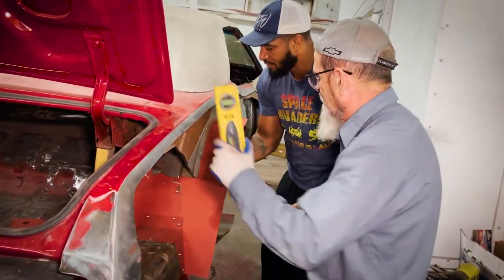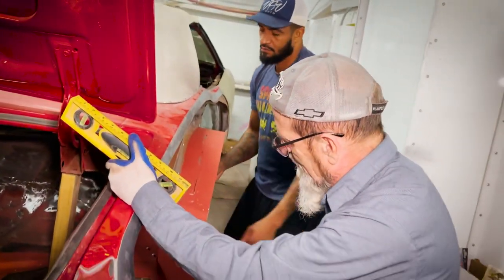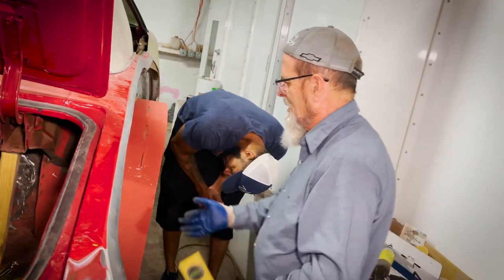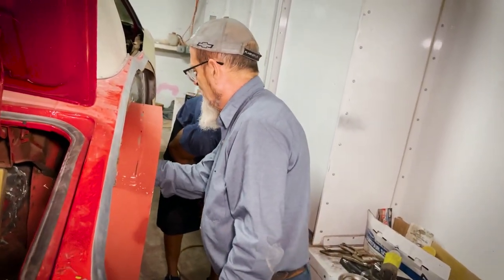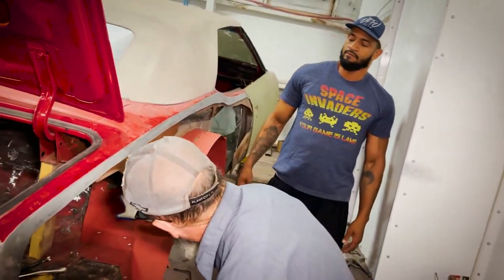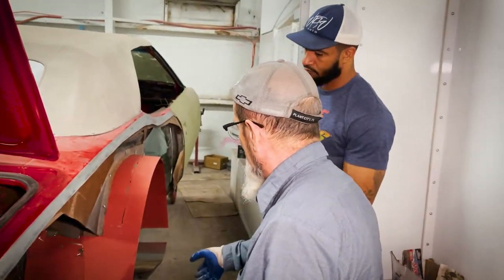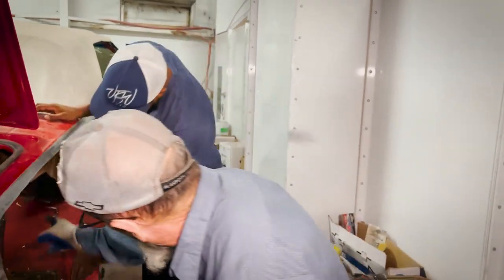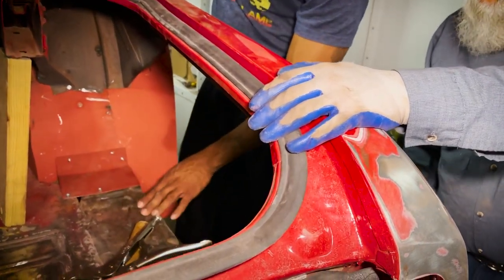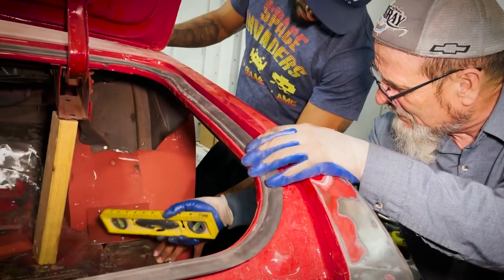What do you do about this overlap — are we going to butt those? The overlaps are going to get cut off; it's going to be butted up. Right now it's setting up to make the shapes and get everything where it's going to be, then it's fine tuning. I've got this little gappage right here which we're going to butt into this piece. I've got to modify up in here where the old wheel well is. Once we got this secured, then we can cut that piece out and everything will be cleaned up inside. I was going to put a little plate in it and weld it up, because that's where the body mount plate is underneath right now, so I didn't do any welding because it's still there for alignment.